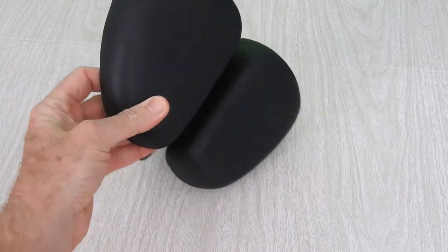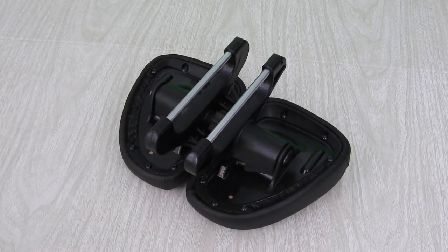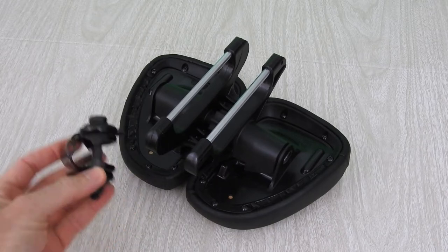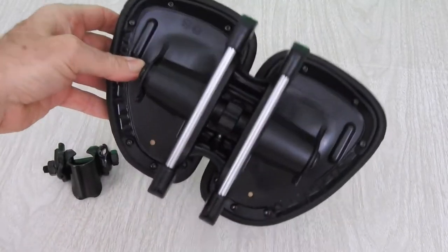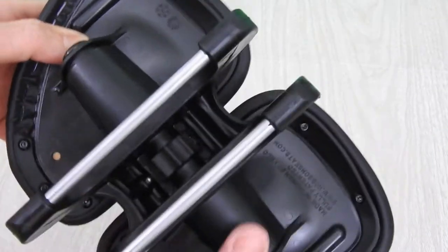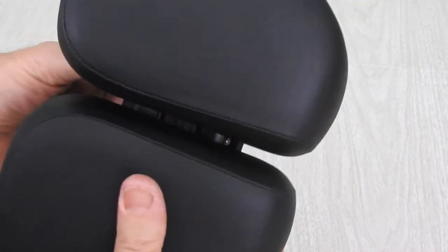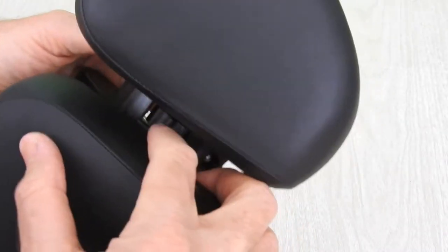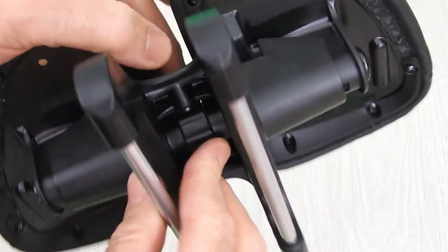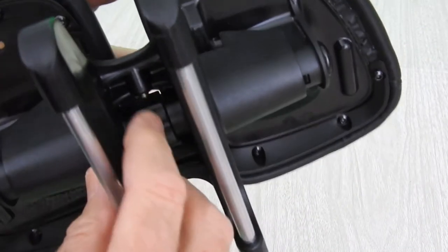Let's take a closer look. Turn it around to the other side and you see it has two rails. It does not come with the clamp for the seat, but I just happen to have one. You can see it has a dial and you can dial the width of the seat. When I turn the dial you can reach it from either side to open it wider — see, it's getting wider as I turn that. You can also reach it from the top, so this is adjustable even after it's mounted on the bike. There is also a set screw right here — after you have it in your position, you can lock it in place with the set screw.